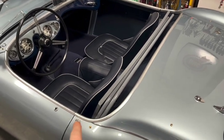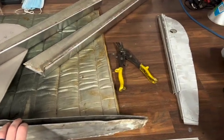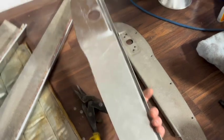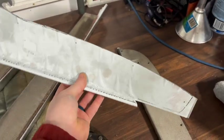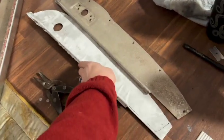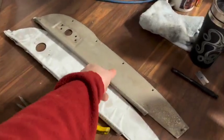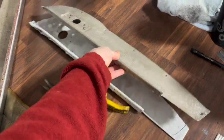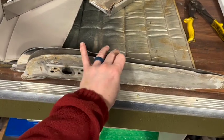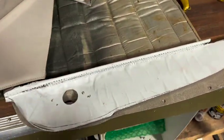The turn snaps are chrome, and of course the female part that goes on them is chrome as well. I'm cutting my new aluminum door trims — they come with a protective coating to protect the face which I'll peel off at the end. They come oversized, so you've got to cut them down. Luckily I have my originals — actually these were used at the body shop when we fit up my car, so I know they fit properly. I'm using them as a template: laying on top, tracing around, and cutting it out. I find it easiest with these to stand them up on end and work on the backside — a lot easier to see what needs to be done.